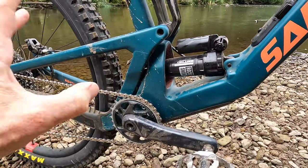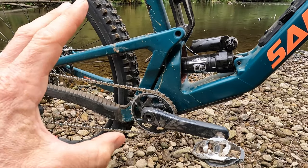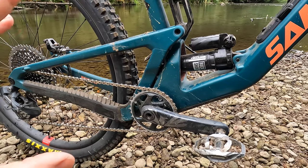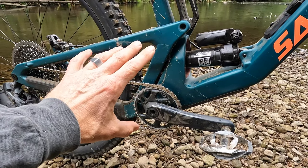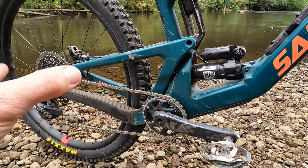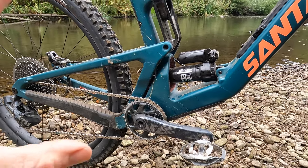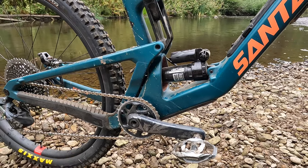The major change — while the travel is the same — is that this new version of the VPP uses smaller pivot axles and smaller bearings, similar to the old Tallboy, although they are actually slightly strengthened up from that shorter travel bike. This moves the linkages closer to the bottom bracket, which has two advantages: on the smallest size you can get the back end right in, so there's a 3mm difference in effective chainstay length across all bike sizes to keep it proportional. Significantly for the suspension, it means it's both more linear and more progressive in terms of shock rate.